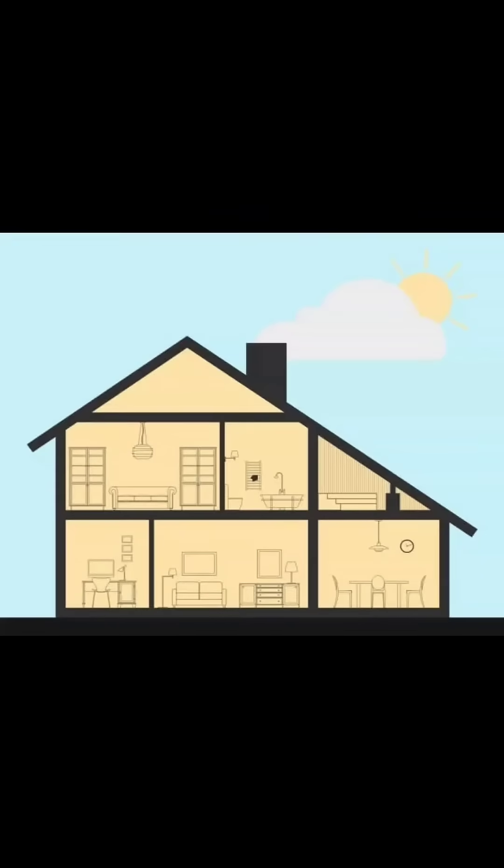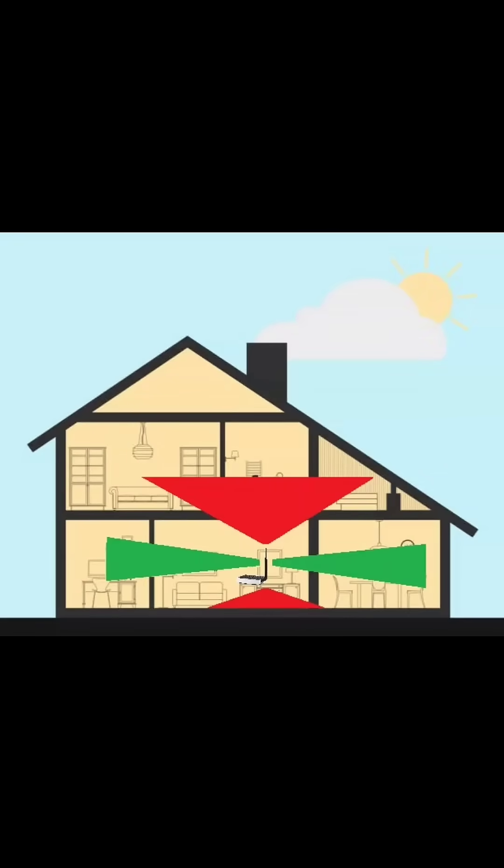In a multi-level home, the position of the antenna is important to eliminate possible dead zones. Routers with two antennas emit two Wi-Fi streams, and can overlap or be angled to cover larger areas. Because of the torus shapes, the dead zones still exist above and below. If you angle the antennas too far, you'll start to create dead zones along the horizontal, which is bad for Wi-Fi clients on the same level.